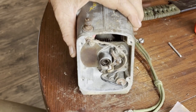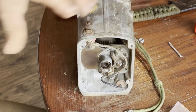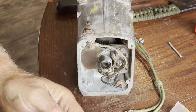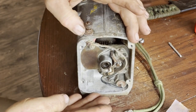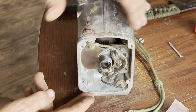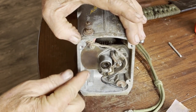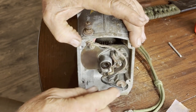Move right on. Let's get our cap kind of cleaned up, and I did find somewhere, not much, but there's enough of this JB Weld. I'm going to blend it together, and I'm going to get the cap on, gasket on, bolted down with my new fancy chrome bolts, clean off the cracked edges of this corner piece, and just cover it with some JB Weld and put them in place, tighten them down.